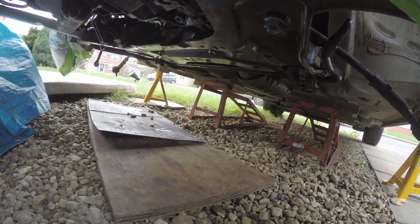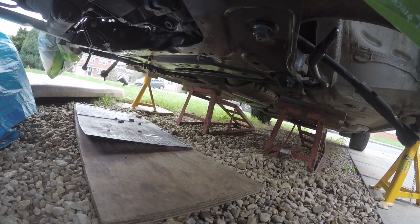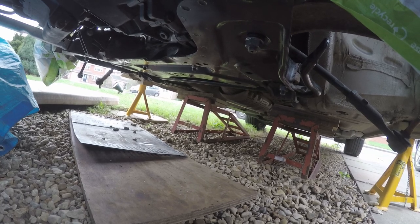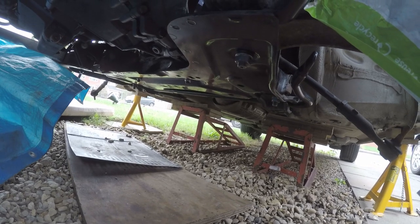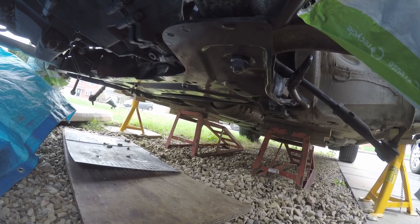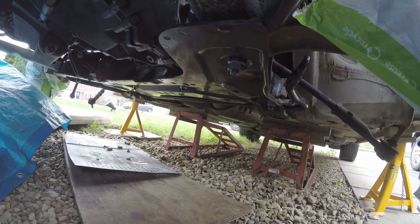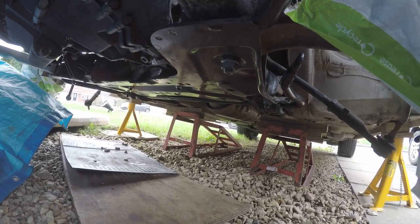The other ones I inspected, and if they looked okay — the threads on both the nuts and the bolts, if they look perfectly fine and they weren't in too bad or rusty condition, I'll reuse them. They recommend to use new but it's about £2.50 a bolt and the price starts getting a bit too expensive. Generally if they're okay — the torque yields are roughly around 100 Nm and the majority of the torques are around 100, so they're not really 10.9 grade steel, so that's not really torque-to-yield sort of torque strength, so to speak.